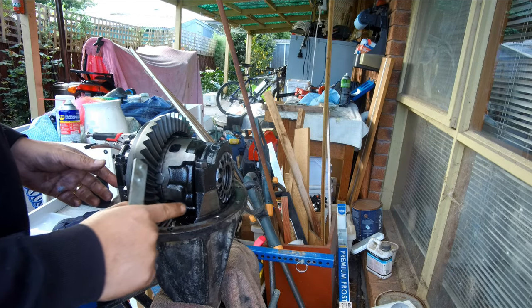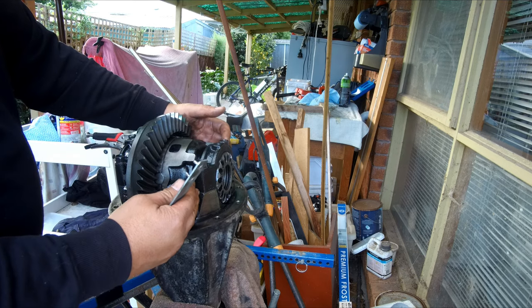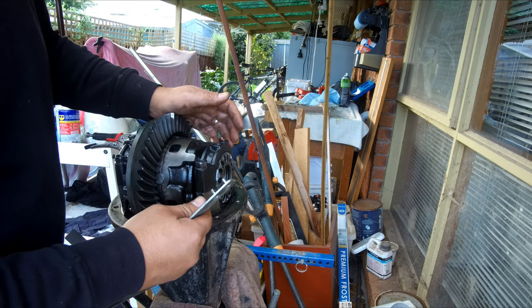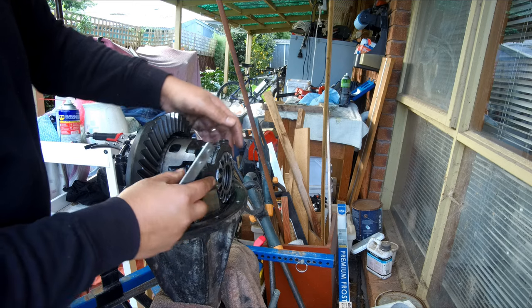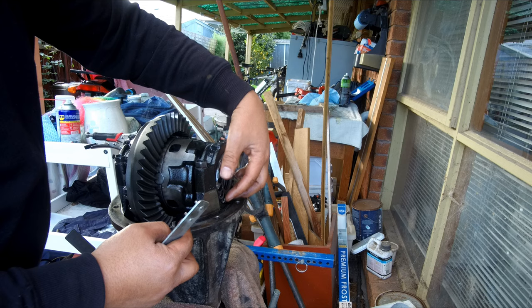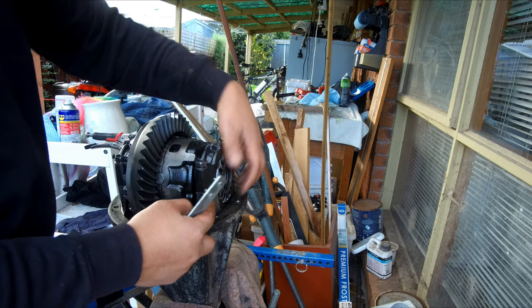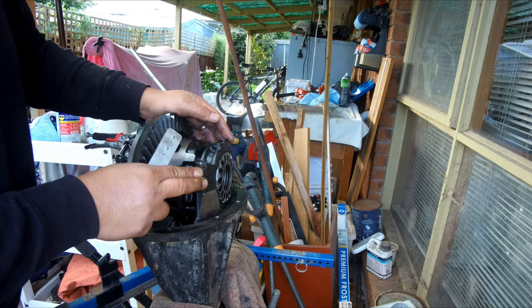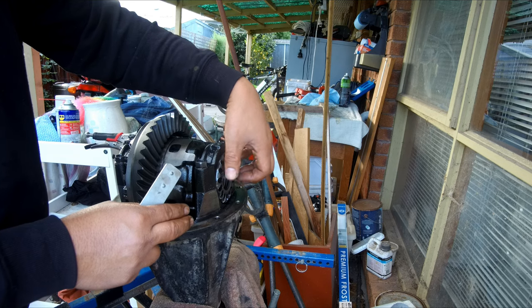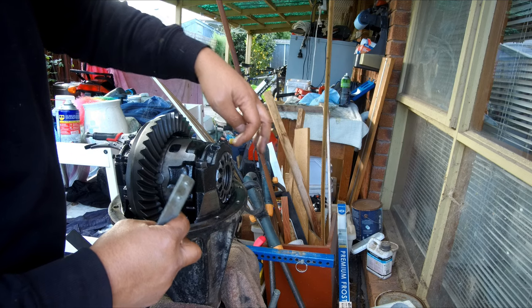So the easiest way, after we put this side correctly, this needs to be under tension, which means that we can't just put everything in place. So what I did was just remove the top cap, place this assembly of this nut to the bottom side, which is very easy to find the thread, and then place the top cap again, which then will make the assembly untensioned. So just need to retension to the original location.